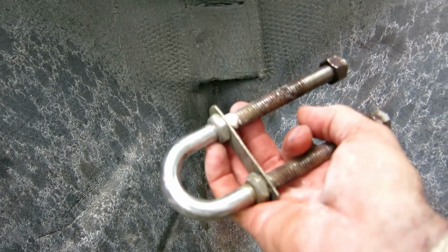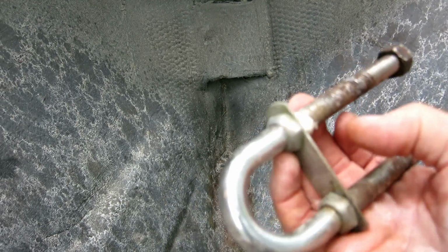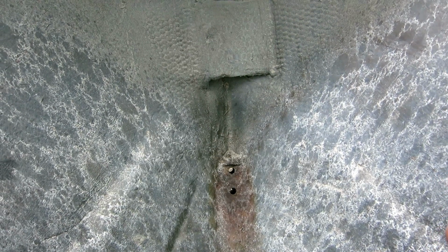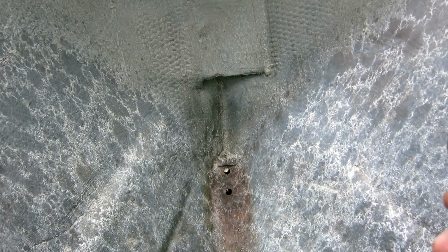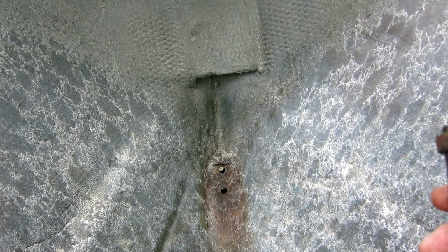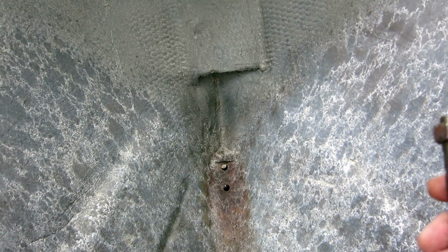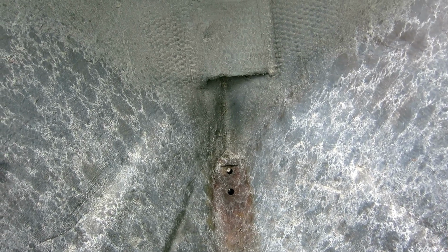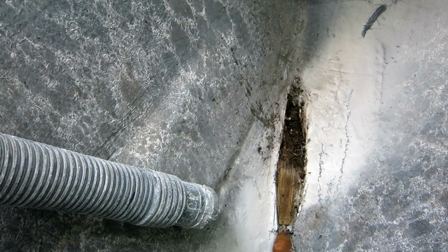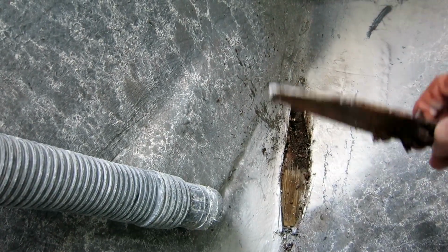This is the eye in the front of the boat. Should be like one of the strongest things on the boat. But I noticed rust streaks coming down the front of the hull. So I figured maybe they had a stainless 304 plate that sometimes stains. And I came on the inside and there was just a plain old steel plate that just fell apart as soon as I touched it. And I went, geez, that's kind of cheapo. But then I thought, well, you've got 2 more inches of glass. That's pretty strong. And oh no, that's totally hollow because they had a block of wood behind that. So the strongest part of the whole boat, there was nothing behind it. But I'll fix it. Yep, pretty crappy.